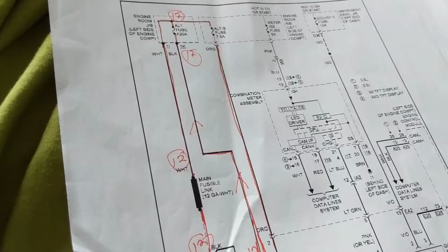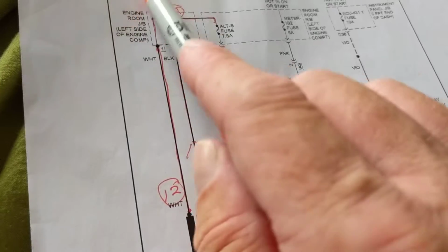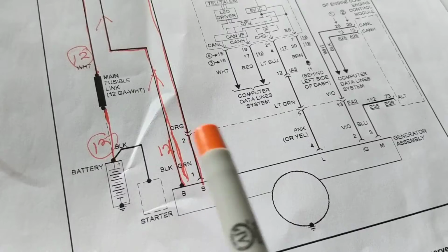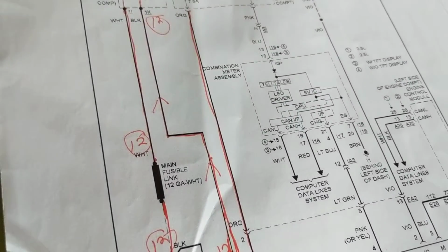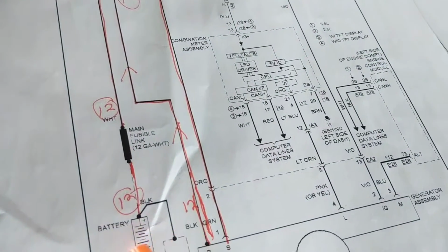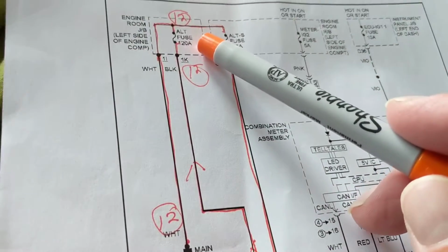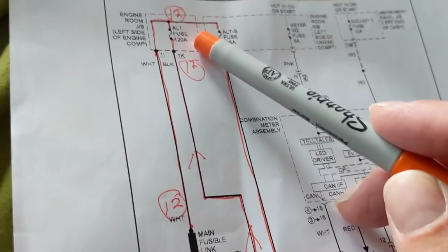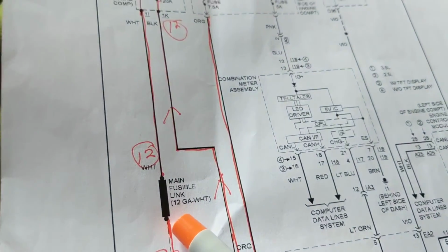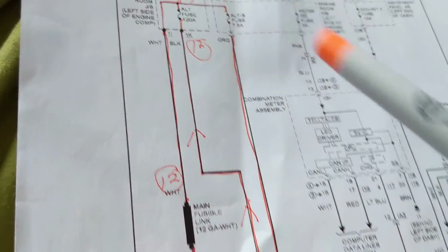How do you go about it? Well, I leave one lead over here at the battery. I come back to the other lead over here. One positive here and one negative over here or whatever. It doesn't really make a difference. Right now I'm just looking for continuity. I want to make sure that this fusible link is okay, and I want to make sure that this big fuse over here, 120 amps, is also okay. So we have a protection device here for the wiring, and I have a protection device up here rated at 120 amps.